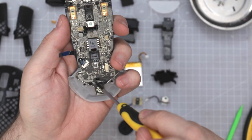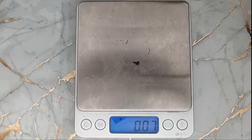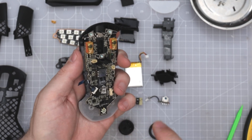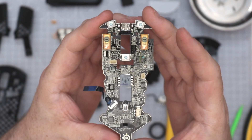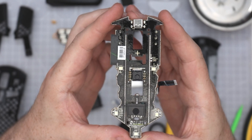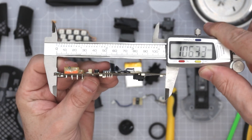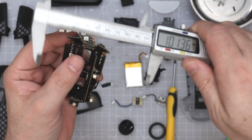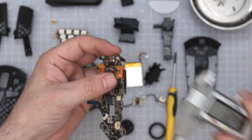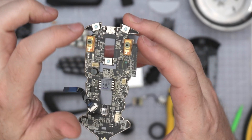Four screws on here. Different looking PCB — trying to trim out some of the weight though. Very complicated PCB-ing. It's a long PCB. Congratulations to us — it's got the longest PCB I've ever seen in my life. It's 0.9 as well, not 0.8 — interesting. We're also rocking 80mm TTCs, which I find a little bit mushy to be fair. And the rest of these are little cheap-ass switches.